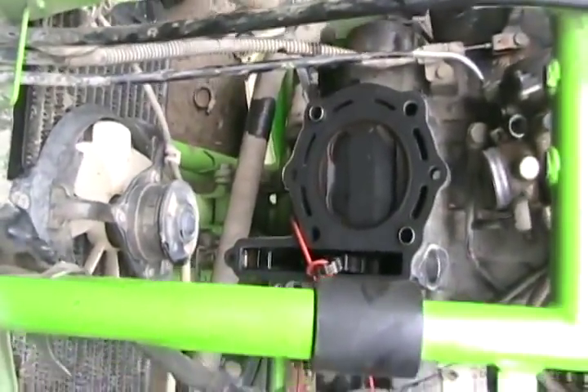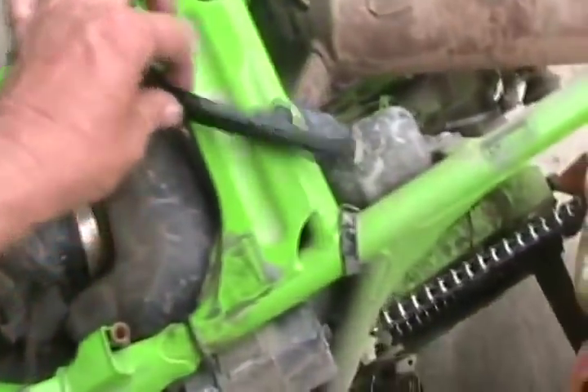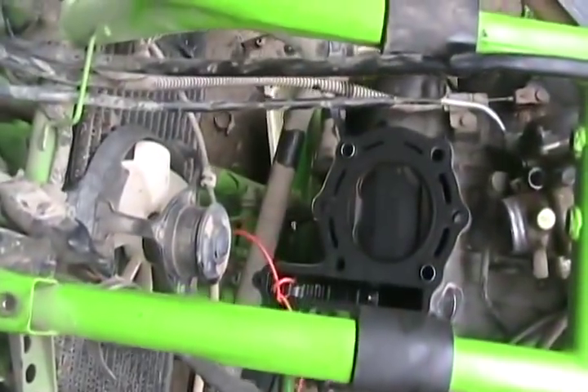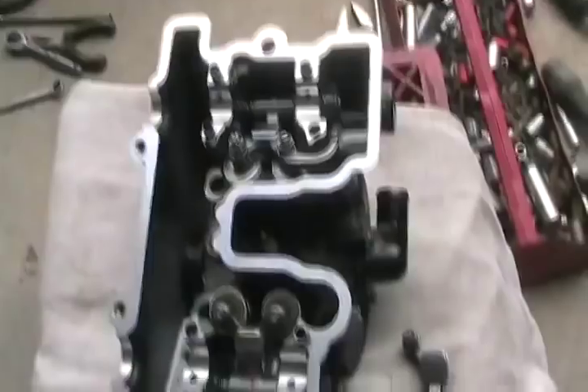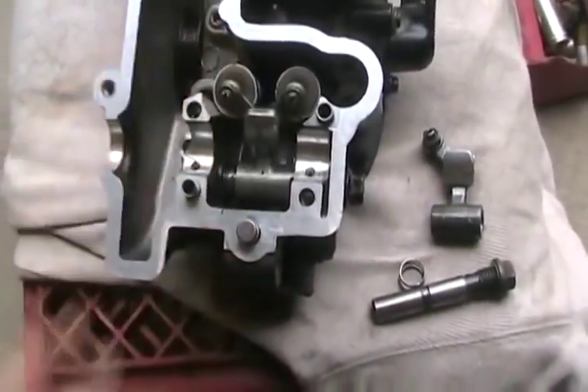I just take a handy little screwdriver, pry them open, shove the screwdriver in between the valve and the valve seat — it doesn't hurt anything — bend it over a little bit and keep trying, opening and closing them until they don't move sideways anymore. They're fixed, they won't break, and it won't ever cause a problem. You can slam the whole thing back together and be confident you'll have perfect compression. I've double-checked all four valves by pressing them and letting them go to see if they move side to side, and now they're all good. I've cleaned the gasket surface, put the new head gasket on, made sure the two alignment dowels are in there. I removed the cam chain slide to make it easier to put the head back on. Before I put the head back on, it was easier to change that broken rocker while the head was off, so that's done.